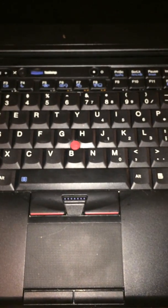All these little tabs right here, they slide down, then your keyboard is secure. Then you put the screws all back in from the bottom, and you've just reset the power-on password for a Lenovo.